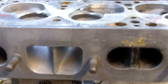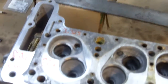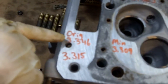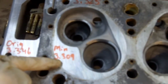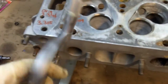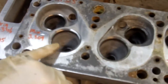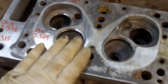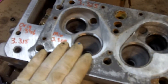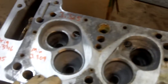Now we're going to take a look at the cylinder head, which is really critical and which everybody seems to want to screw up the most. The original thickness is 3.346 inches, and the minimum thickness is 3.309 inches. There's only so much material they give you and only so much you can take off — you measure it with a micrometer. The reason for the minimums is that the intake valves are almost flush with the surface of the head, and the pistons come up slightly above the deck of the block. Without proper clearances, pistons and valves will meet and destroy things.